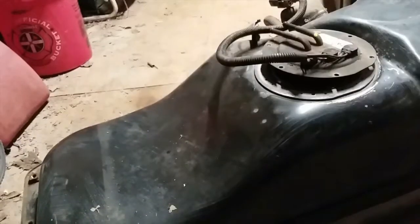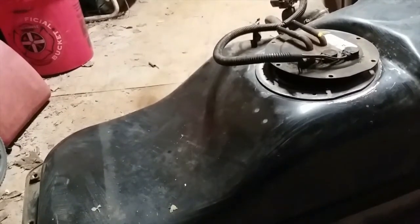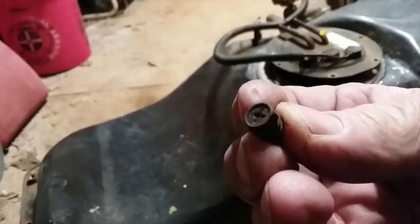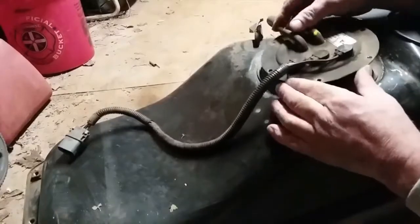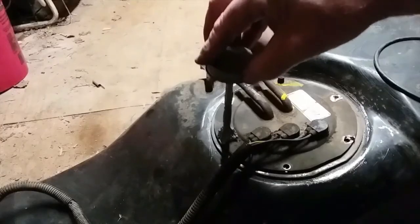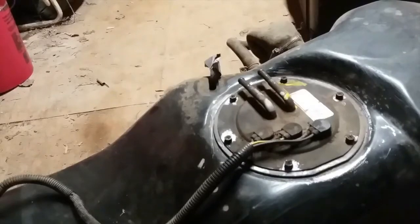It was $7, which is a lot of money for an O-ring and some screws. But it fits up here and it's sealed underneath. I'm going to use the screws that came out of it. The new one is Phillips, and the one that came out — you can't tell, but it's Phillips and hex head too. Since it's too hard to put this on the screws, I'm just gonna put a little dab of anti-seize on there. 8mm on the money. I couldn't find a torque spec on it, so I'm going to do the German method — good and tight. That is one fuel pump done.